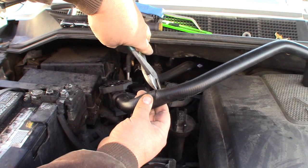Okay, now I go pull out my bolt. Pull out my rotor. You can see she's pretty rusty. I tried to clean her off and lube her up, but she's not loose yet, but she's making a little noise on spinning, and she's spinning really free. And she should be kind of stiff when you spin her. So, oh well. I'll yank her out of here.